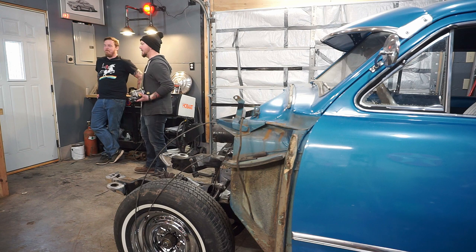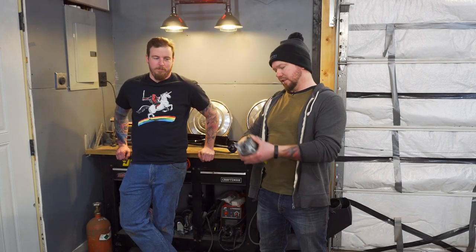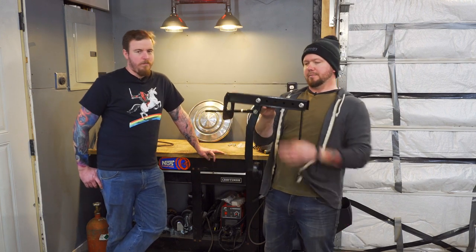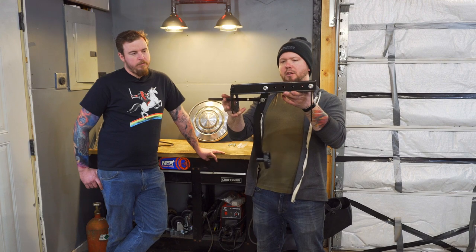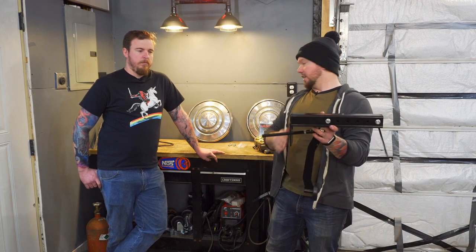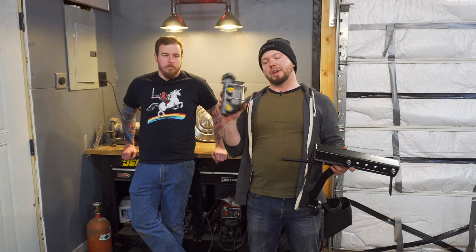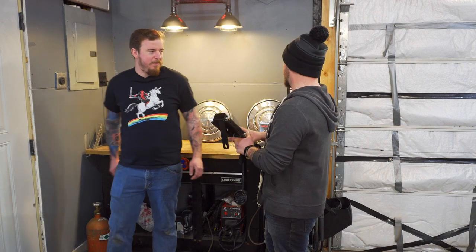What we're going to be doing is keeping manual brakes and using a big master cylinder that's going to attach to a hanging brake assembly. This guy — they're all kind of the same. This is an eBay one, identical to the Speedway ones as far as I know. What this does is it bolts on the inside of your car against the firewall, and that's why it's got the extra holes drilled in it, unlike the Speedway version. This one's been made to work with a manual brake setup.